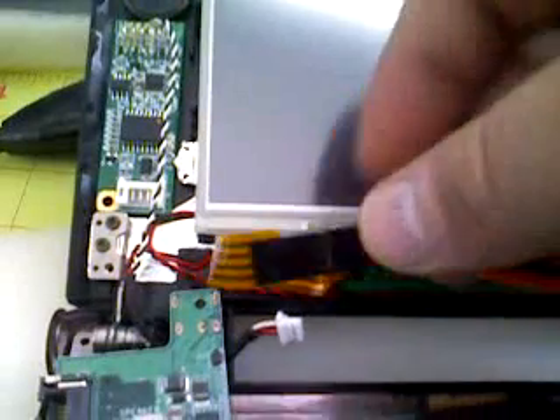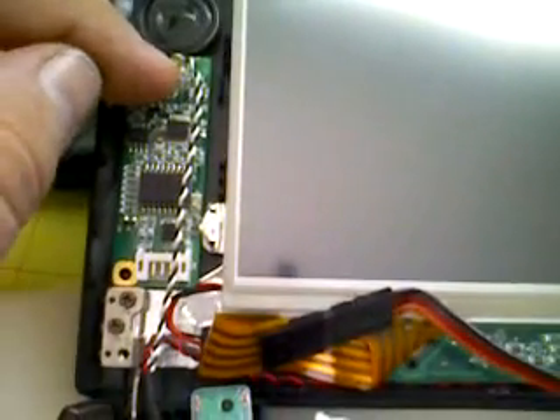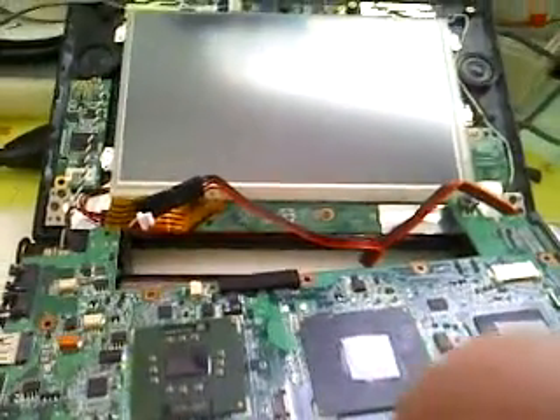The wires from the touch screen to the controller won't be coming through the lid either, so it'll all be tucked away nicely right in here. If you don't cut the controller it can't fit here, and I don't want to relocate the speaker, so it fits real nice and snug in that spot. I'll throw some double-face tape on there, then wire the touch screen to the connector, and run the USB cable right to the hub underneath the motherboard, going through the fan notch — that way it'll be a nice, neat installation and won't give me any problems closing the casing.